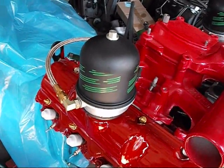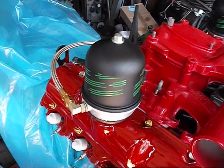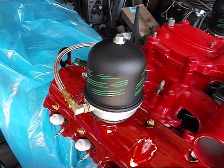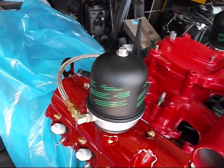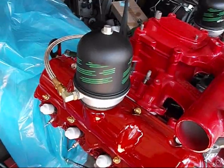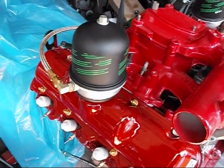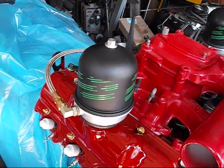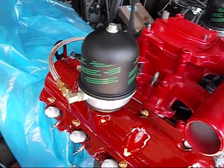The system maintains proper oil pressure on the engine and on your gauge. In actuality, this oil centrifuge has no effect on your oil pressure or your oiling system because that stays 100 percent intact — you still maintain your full-flow filter just like you always do. Bypass systems really cannot affect your engine's lubrication system. If you have those kinds of problems, they're due to something else, like oil pump debris. This system will not cause the problem.